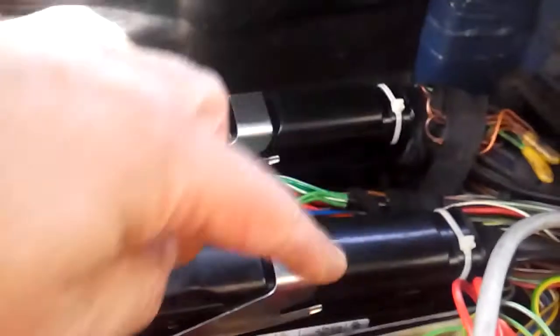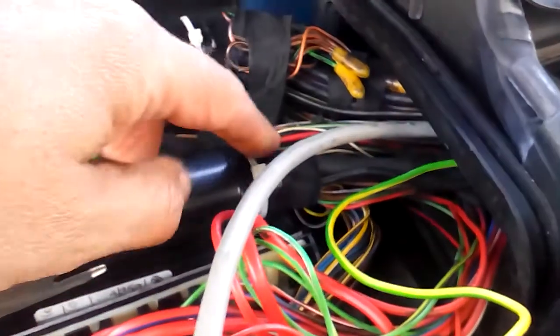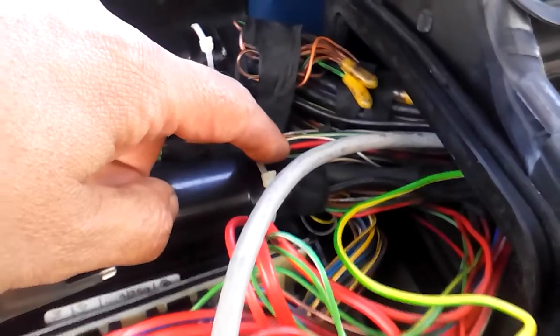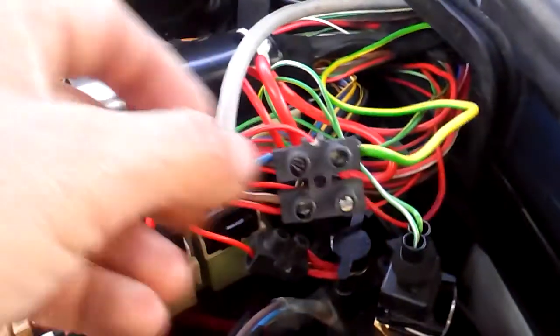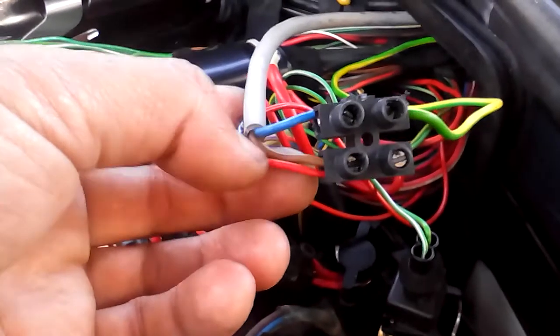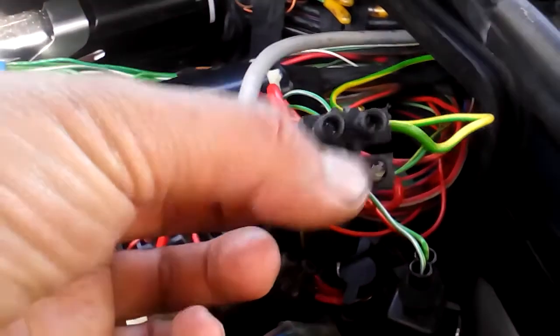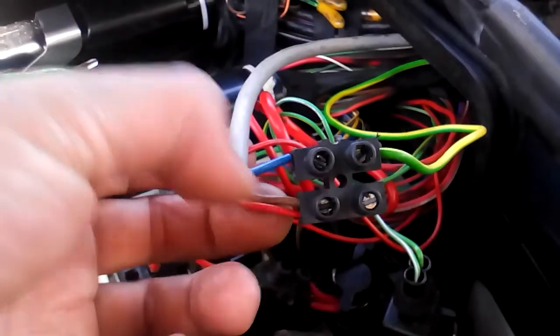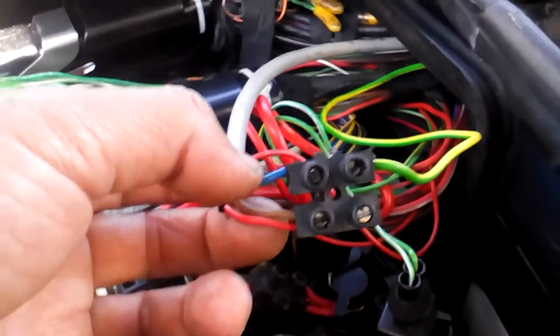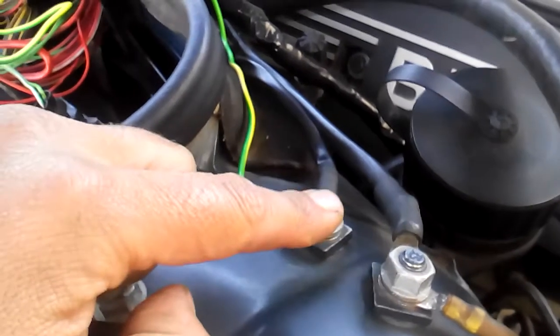Here's the ECU and here is our transmission control module. You can see the red wire — that's the one we're interested in. The positive is joined here with our stabilized 14.1V plus and connected into this domino connector. The negative from the battery is connected to the ground here via the green wire, which is connected with the other grounds to put everything at the same potential.